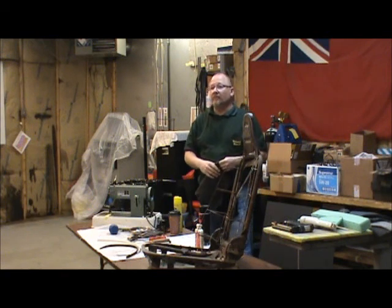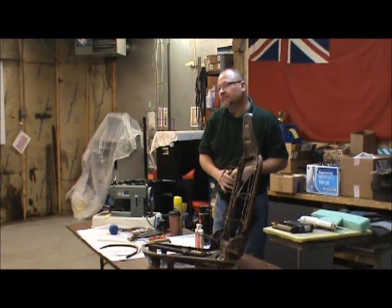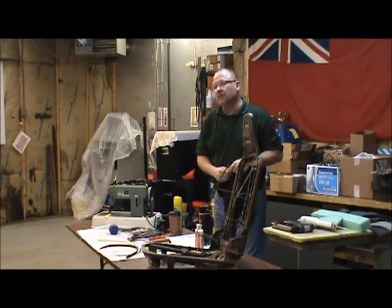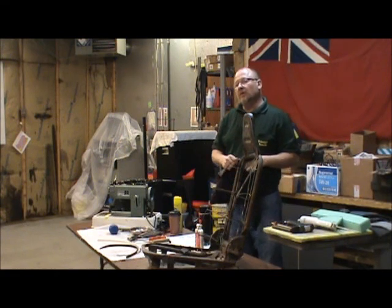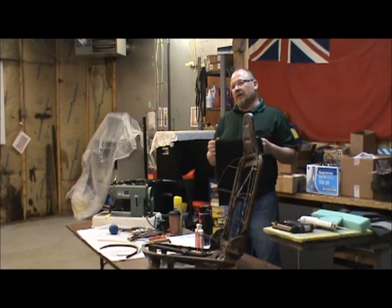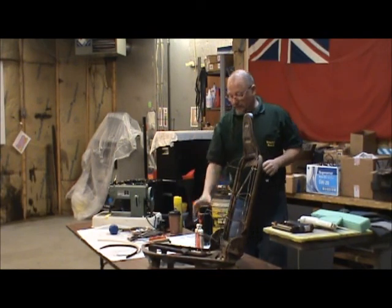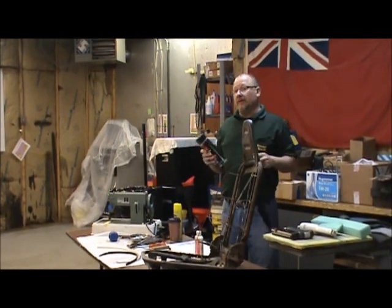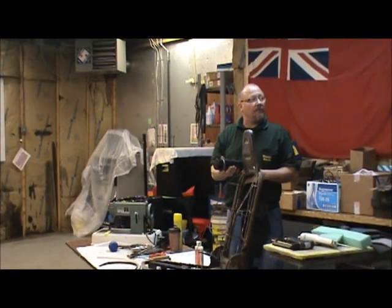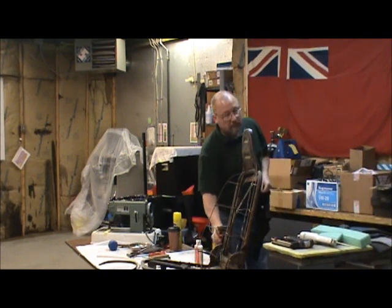Yeah, two questions. On the door, gluing the wood blocks that hold the curtain on the TR3. What kind of glue do you use to affix it to the door? Well, there's a couple of different glues you can use for that. You want to have something naturally that's got some weight to it. Sprays don't have too much weight. They're not going to go in and sink in and hold on. You know what you could use? You could use panel bonding adhesive.